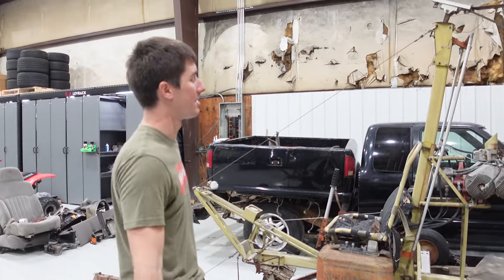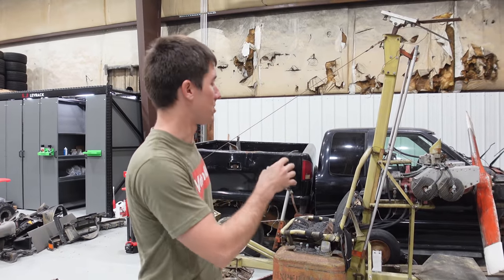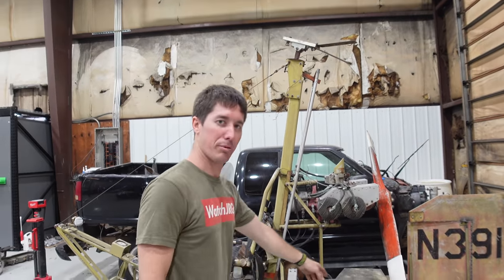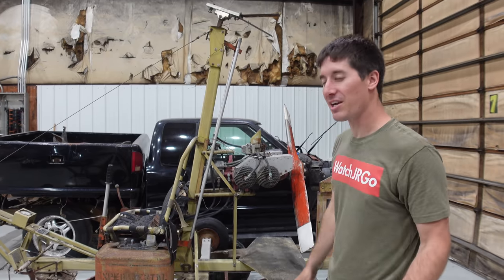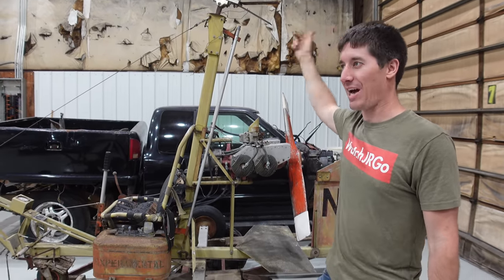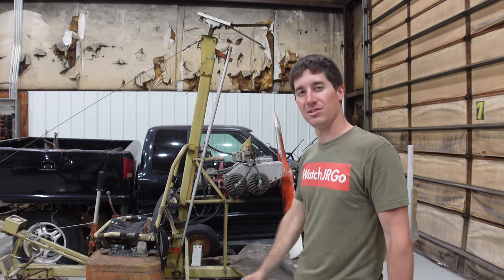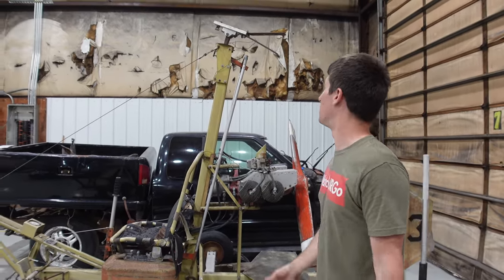This thing's all here except for our upper rotor — that's very missing. If you guys don't know anything about gyrocopters: yes, it's a rotor, but it's not powered. This thing freewheels up here. To take off with a gyrocopter, you only have a pusher prop. You spin that thing up and point it down a runway and it gets going — like 60-something miles per hour, a sketchy mile an hour. And after that, the rotor just starts to turn. So you better hope the rotor takes off, otherwise you're in trouble. It goes faster and faster and eventually the rotor goes fast enough that it creates some lift and you helicopter up out of there. So the rotor is not driven — only the prop is driving your gyrocopter. The whole thing's sketchy — if you make a bad decision, you're just hoping you can autorotate down if it comes to it.